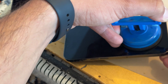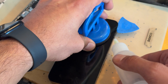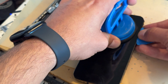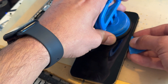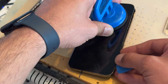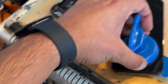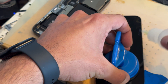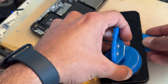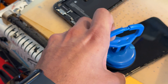Once you've separated it enough there'll be enough room to fit one of the little guitar picks in there. I'll carry on lifting with the suction cup, run some more alcohol down the edge, and then very slowly run this guitar pick along the edge to separate the screen from the chassis. If you find any resistance just add a little bit more isopropyl alcohol. If you have a heat mat I'd recommend leaving it on there whilst removing the screen so it stays warm.